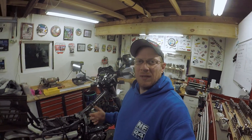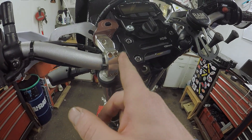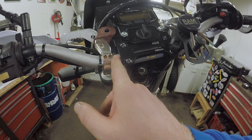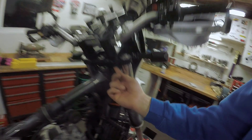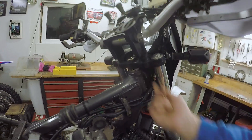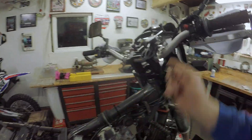Got the seat and tank off, luggage is off. Next I'm going to mark my handlebars right where they are with a sharpie — just a dot, that's all you need. Then I'll take the top mounts off, loosen those 17-millimeter nuts down here, and loosen up the bar clamps to pull the bars off the risers. The risers are so deep that the bolt always ends up going inside and it's a pain getting it back down.